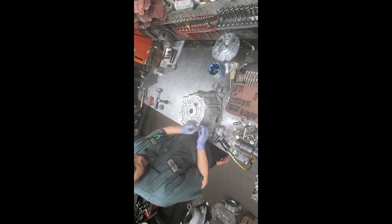What I do is I usually try to put the bolts in and snug them tight on the step. The thing is, it's got a metal core in it with a stopper that will only allow so much squish on the gasket. So you can close it here, not tightening them way too tight. Just a couple of hits with the hammer. And again, the gun is set on medium. If you put it on high, chances are you would overstress the threads or pull threads or strip or break a head off a bolt.